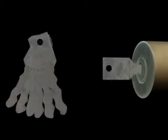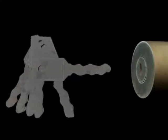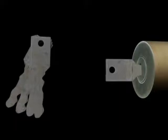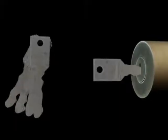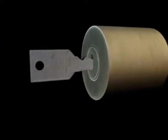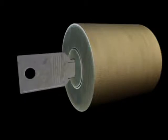If lock tolerances are poor, tryout key makers can cut a notch between two depths, and it should work for both. In fact, before 1968, a set of only around 64 tryout keys could open any GM automotive lock. They're simple to use. Insert the key, jiggle it around slightly, and work it in and out while trying to turn the lock. If it doesn't work, move on to the next key. With just the right touch, with cheaper locks, and with luck, you can be very successful with this method.